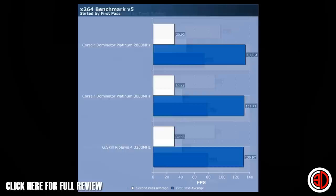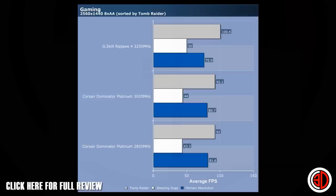People are going to ask how much of a difference it makes with gaming. We've got this graph — all at 2560x1440, all maxed out, arranged by Tomb Raider, Sleeping Dogs, and Hitman. Pretty much everything in this graph responds better to the quicker memory apart from Hitman Absolution, which was the only one where there was a slight dip at 75.9. So we can assume Hitman is a little more CPU-dependent. But it's quite interesting to see a significant increase going from 2800 MHz up to 3200 MHz even without the CPU taken into account.